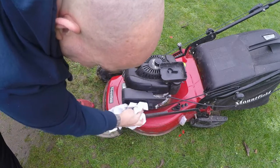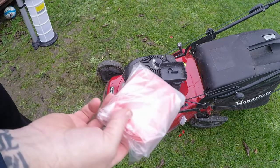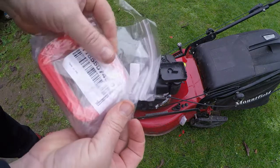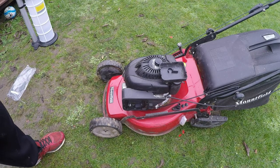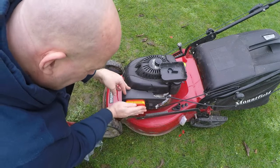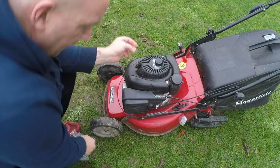So that can be discarded. Just give it a general clean — get rid of any oil, petrol, dust, or debris. Fantastic. I've got a brand new genuine part here. The part number for this one is 118550748-0. This will help the engine no end because it's better sucking the correct amount of air when it needs. This air filter will literally just pop straight back on to its housings. It sits in there and we then just replace the air filter cover. So that's the air filter done.